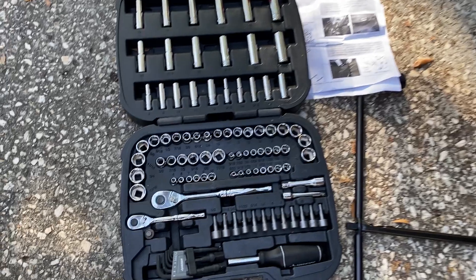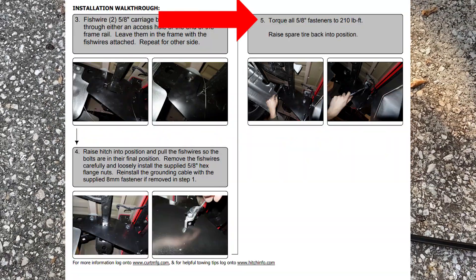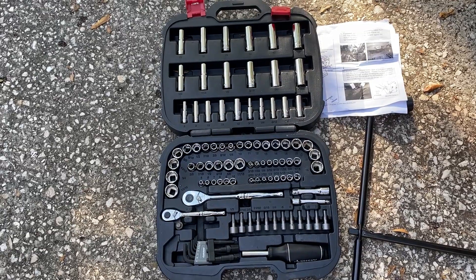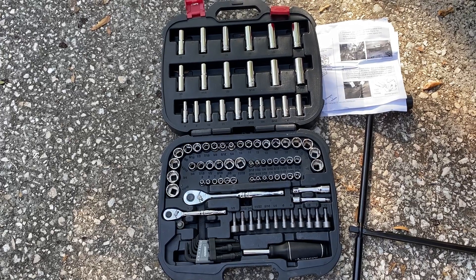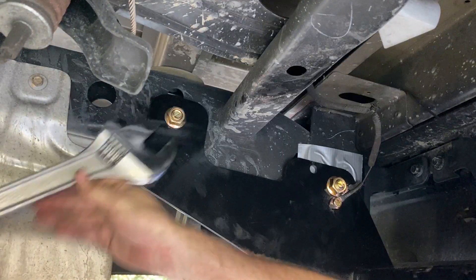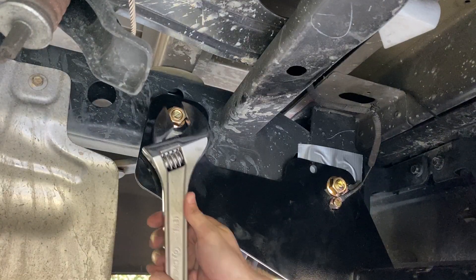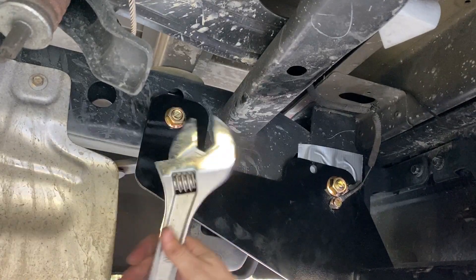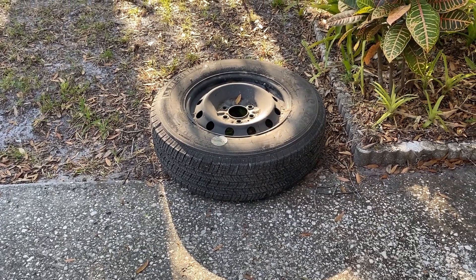It was at this point that I got to the step in the directions that said I needed to tighten the carriage bolts down to 210 foot-pounds. Standing there looking at my Fisher-Price socket set, I realized I had no torque wrench. So I did the best I could with a Crescent wrench for the time being. I had no immediate plans to tow anything, so I just needed this thing to stay attached until I could get the tools. In the meanwhile I left the spare off.